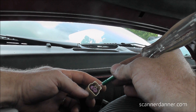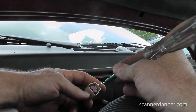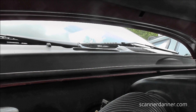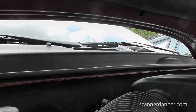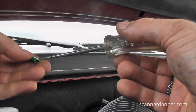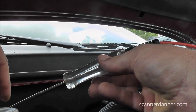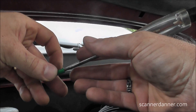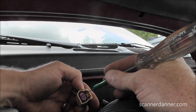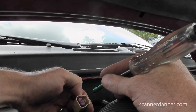Since the solenoid is power-side controlled, the black wire which isn't lighting my test light should be a constant ground. It could be computer-controlled too but I'm pretty sure it's not. To check, I'm switching my test light polarity to battery positive. Any time you move your test leads you better verify the light works - the first time I did this I had a bad battery connection that messed me up. Now connected to battery positive, when I touch this black wire pin, the test light should light if it's a constant ground - and it does.